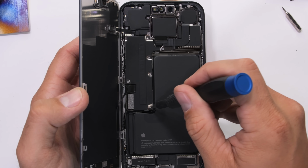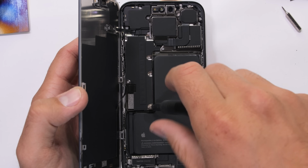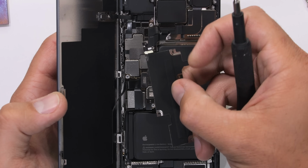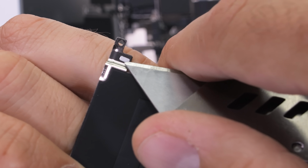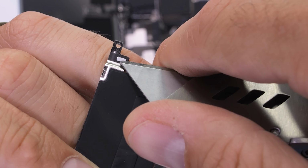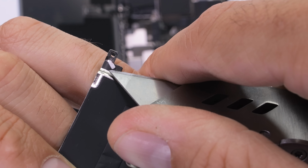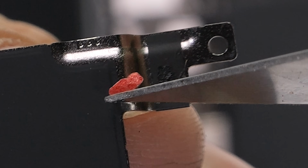To unplug the battery, we use our first of 4 different screwdriver bits, a tri-point. There's 6 screws around the large main plate. And even though the 15 Pro Max is IP68 water resistant, Apple still stuck a little water damage indicator sticker in here next to the circuit boards, which will tattle on you if liquid ever gets inside. Apple doesn't trust nobody. The red bleeds through the sticker to make it pink when it gets wet.